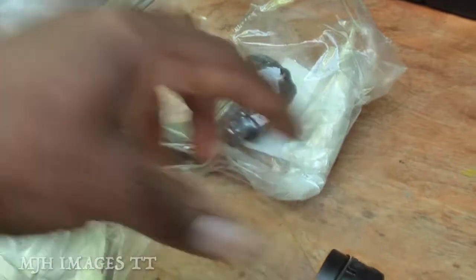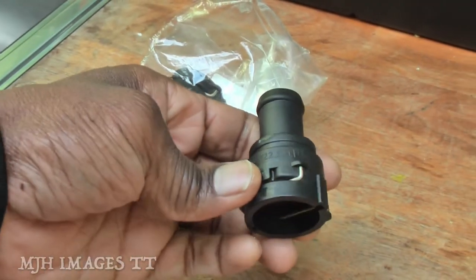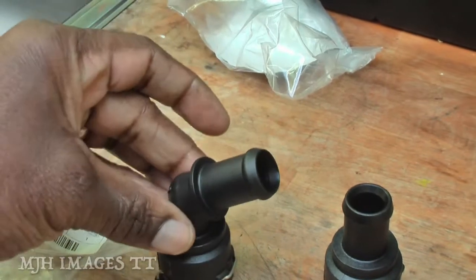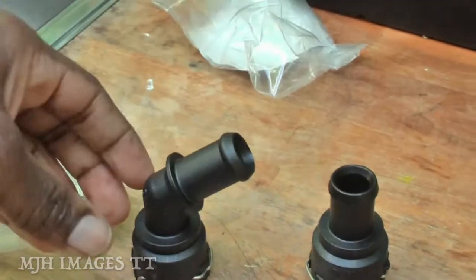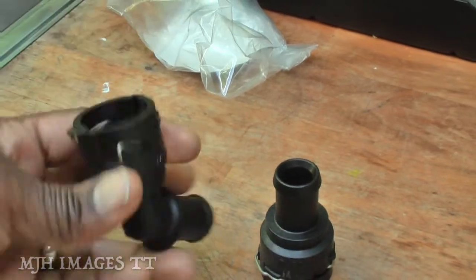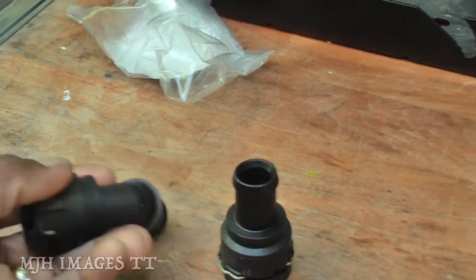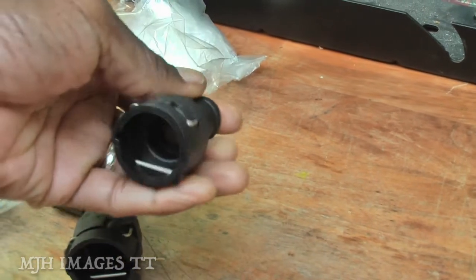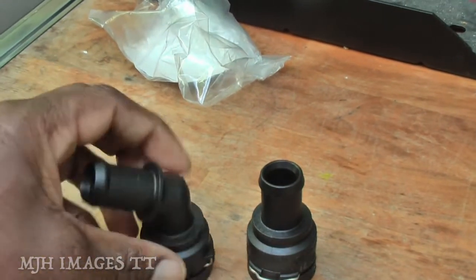Here we are — I'll put the part number in the description below. On my particular model, Mark 1, 2000, I've got one shaped at this angle. You can get these off eBay, but I decided to get this one from the main dealer as the prices were pretty much the same — I just wanted to make sure I got the genuine part. I think often it's the little O-rings inside that potentially fail. Sometimes these can crack, but generally it's the O-rings. I think the O-rings can be replaced, but looking at the price I'd hazard a guess that mine have been on there since new, which is over 20 years.